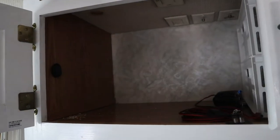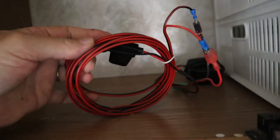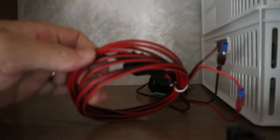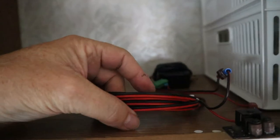Here's where I'm going to install the router. It comes with a 12-volt connection, and that's what I'm going to use. It also came with a regular plug-in, but I figure it's more efficient to hook it straight up to the 12-volt, and it's fused — it's got a fuse in line. I already drilled a little bit of a hole there, but it may not be big enough for the antenna wires. I'm going to mount the router over here and bring in the wires and coil them up here.